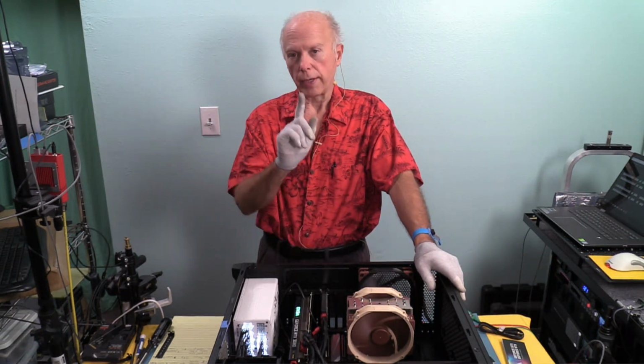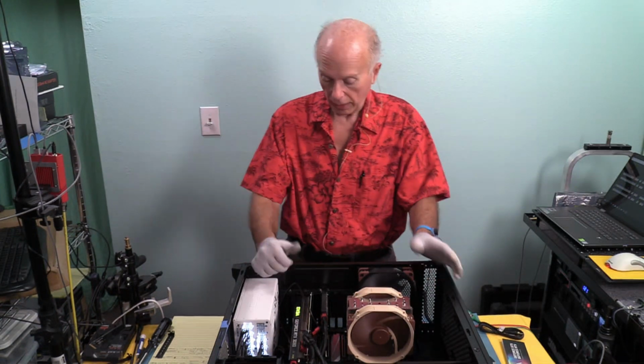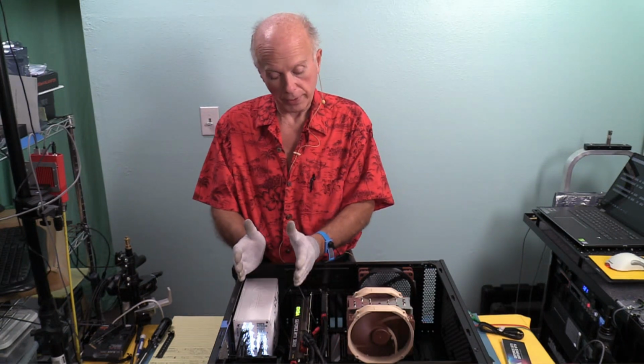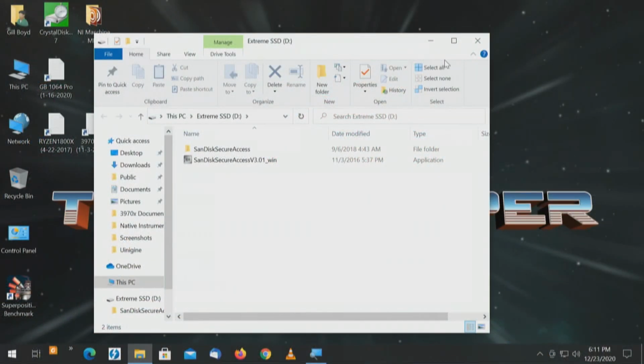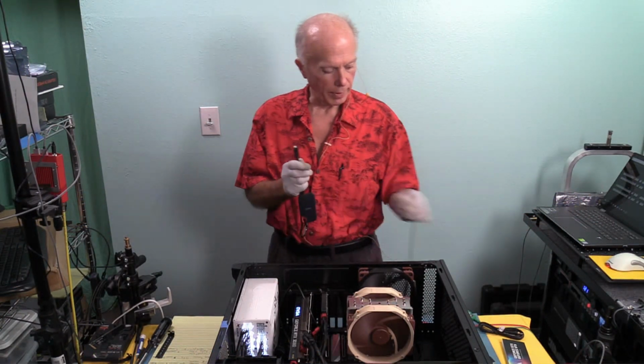But I made sure we didn't have any BSODs, and that's why I've stepped through this process. That was the key thing. And we discovered that, wow, we can't put the video card, a 3080, in slot 1. So anyway, back to the computer. When I unplug this, that'll go away. Just that simple, because we have plug-and-play support.